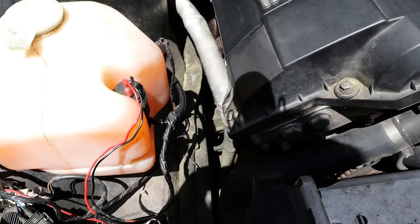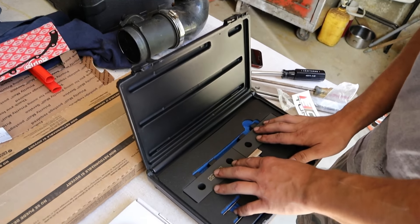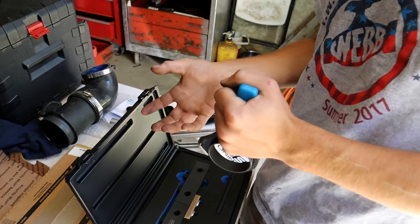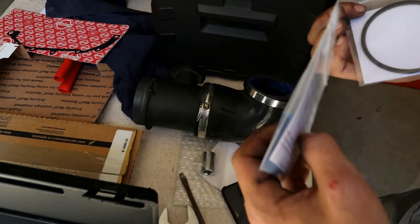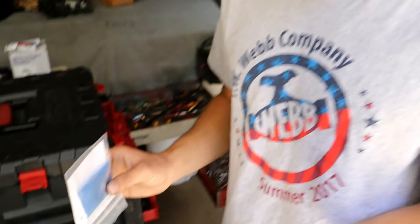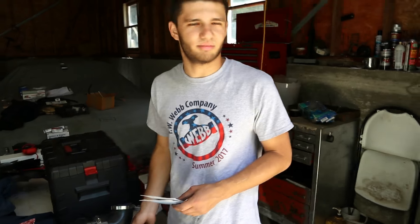Now we have the pretty much the whole Vanos unit right here. Before we start tearing the car down, we're gonna give you guys a rundown of what's needed to do a Vanos job. These are the camshaft locking blocks, a flywheel holding pin, and this is also a wrench to adjust the Vanos — you push it and kind of force the unit out of the gearing. This is the seal repair kit and rattle repair kit. The seals hold oil pressure — the higher the RPM, the higher the pressure, and it'll adjust the valve timing. Some freaky deaky science — basically like VTEC.